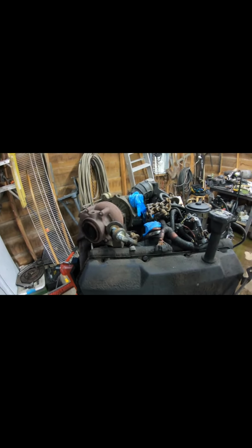before I do that, number one, I'm going to clean some things up in here. They don't look real bad, but it can certainly look a whole lot better. And that evaporator inside of that air box right there is a whole lot easier to get to now. I'm going to take that cover off, pull the evaporator about halfway out, and clean that. And you want to talk about having some good cold air and good airflow, if you've ever done that on one of your trucks, you'll know what I'm talking about. You get some really good airflow by cleaning that evaporator.